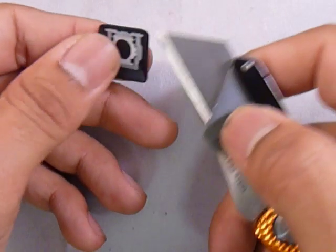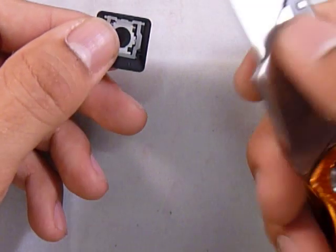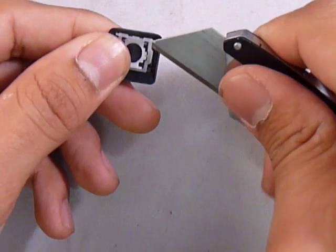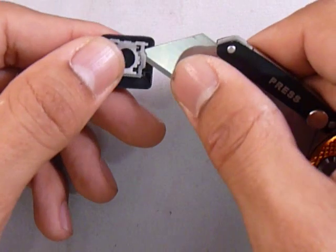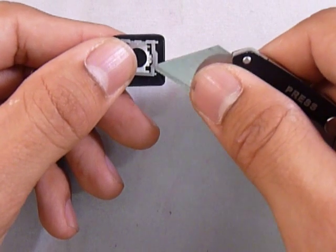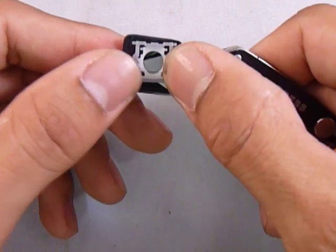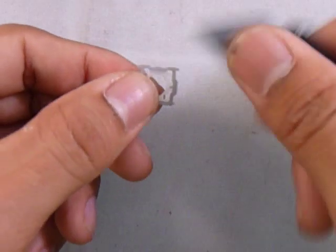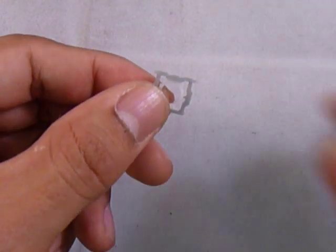You want to take off the tape, then separate the hinges from the keycap. Get something really thin, like a blade, and put it in between the keycap and the hinges. Stay really close to the corners because you risk less having anything break that way.